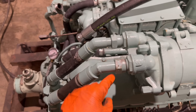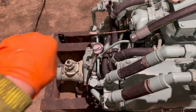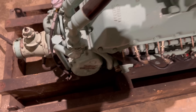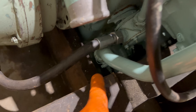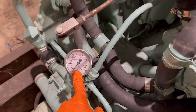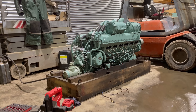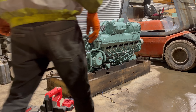I'm also going to have to prime the oil pump before we try cranking it over. So I'll put that funnel in the top of that pipe, pour some oil in, and that should prime the oil pump. I've also connected up my oil pressure gauge, so as I'm cranking the engine before I start it, if I can see that rising, I know the oil is circulating around the engine so it won't seize up.